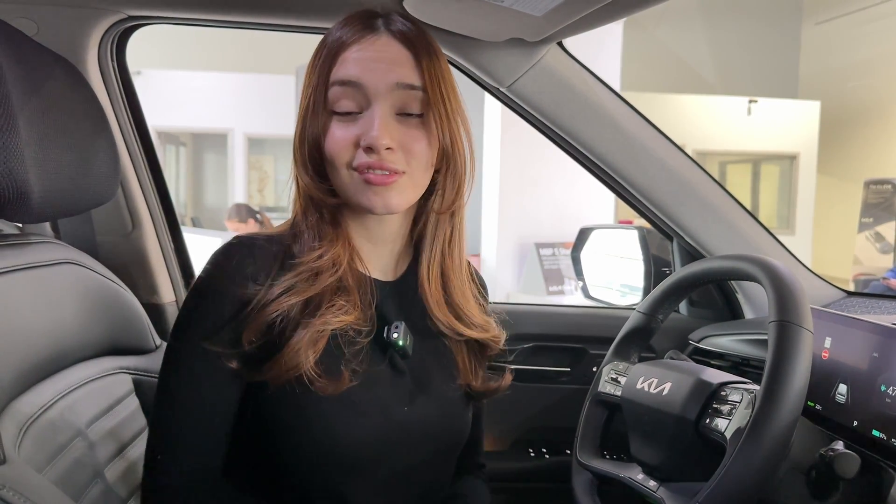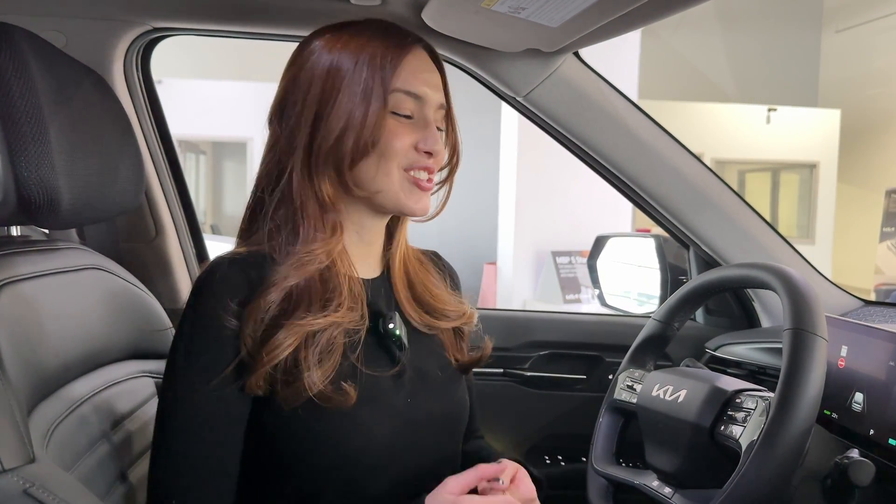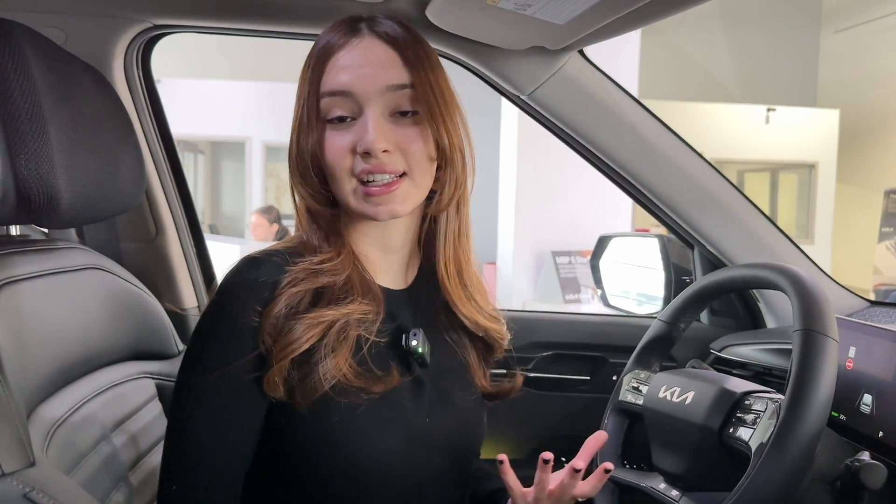You may be asking yourself: my Kia or Hyundai EV is very new — why would I have to clean my brakes? I wouldn't have to do that on a gas car. And the answer is you're right. But on a gas car, are you able to not use your brakes ever? That's something you can do in an EV. If you're someone who is always on max regen or one-pedal driving, chances are you haven't touched your brakes in a while.